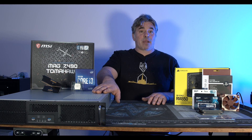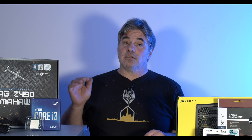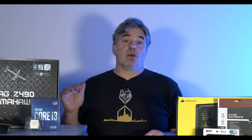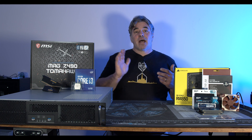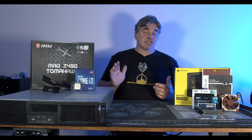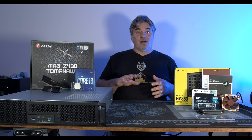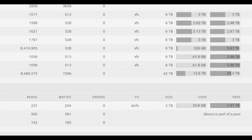The Silverstone case is a 2U rack-mounted server. For this server I'm going to be installing Proxmox and virtualized TrueNAS Core. I'll be using it for video assets for editing on my two channels. Right now I'm editing off my Unraid NAS, putting a lot of load on those spinning disks — over 12 terabytes already — and I don't want to wear out the drives prematurely. So I'm going 100% SSDs.